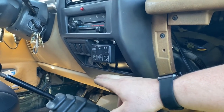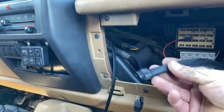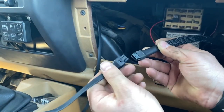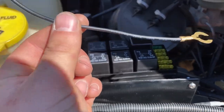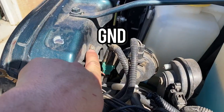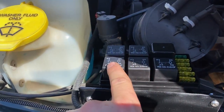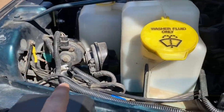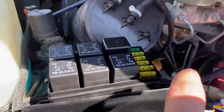I've taken my cabling and zip tied it up along the dash — it's going to come out right here. I have the female to male connector and I'm going to make sure the tab clips in correctly and connect that in just like that. Keep in mind this red wire and this ground wire, which I've extended so I could land that ground over here on the tub of the Jeep. These two wires — the hot and the ground — are the wires that turn the coils on the low current side to switch the relays on and off. You're going to want to terminate this ground to the tub of the Jeep somewhere, and that one ACC wire needs to go to a hot. Those are the control wires for each relay on the low current side.